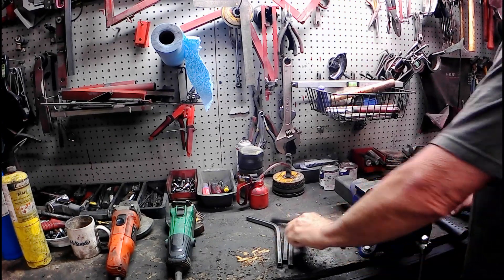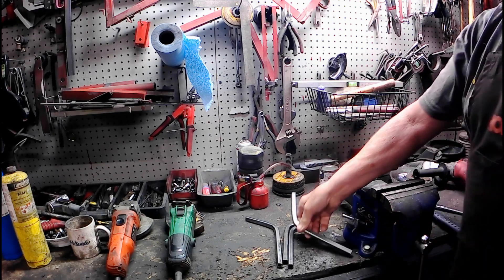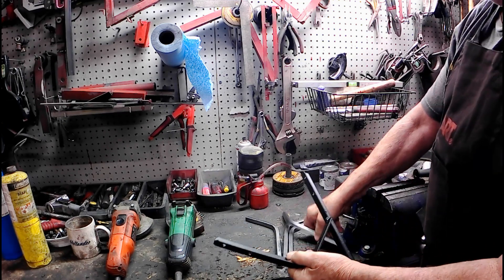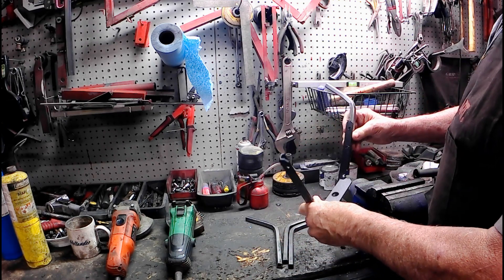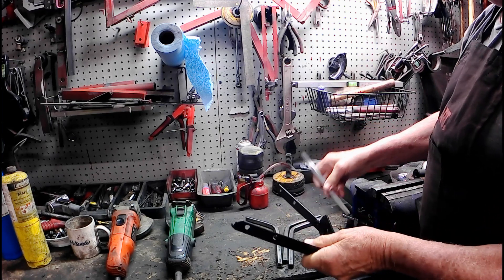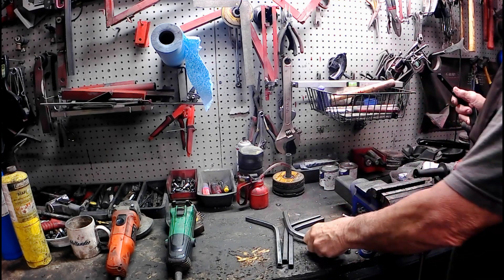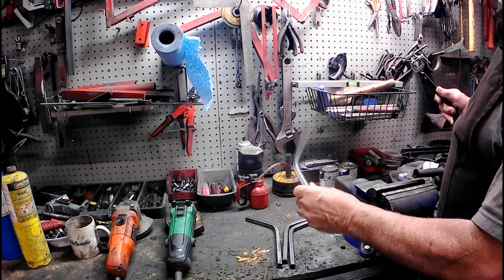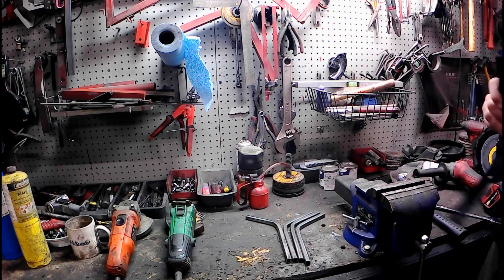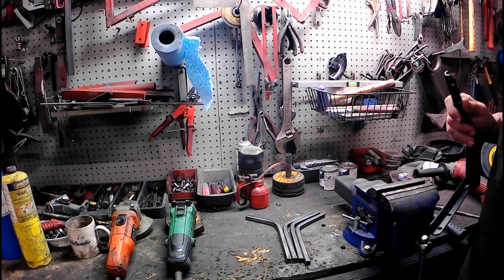Yesterday I made up these, which are the fender mounts. The way those work, they attach to the fender and then they go in here like this — I've got to drill them and everything as it gets along. I use my little pneumatic hydraulic bender to do those. It takes me about two minutes to make four of them — pretty handy deal. I'm glad I went to the pneumatic unit rather than the hand pump unit; much better.